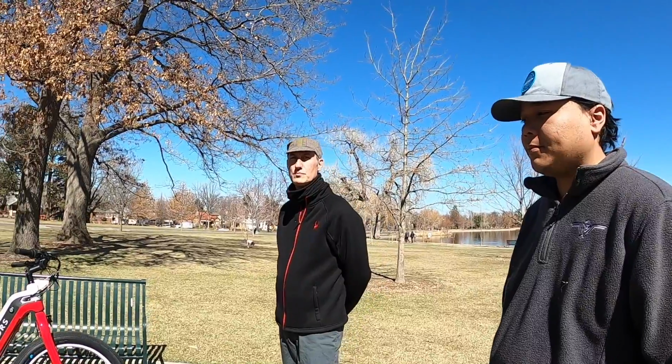What did you think of the shock on the LX? The LX is really smooth as well, being just from SONDORS. I was very surprised. It does have the lockout feature as well, so if you don't want to use suspension on just your main roads on your commuting, you can lock it out. So it is an awesome fork. And on both the Rockstar and LX, they're both weight adjustable. You can change the air pressure to accommodate the weight of the rider.